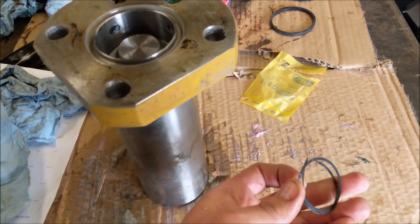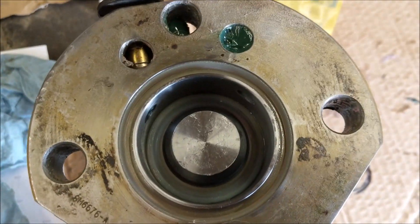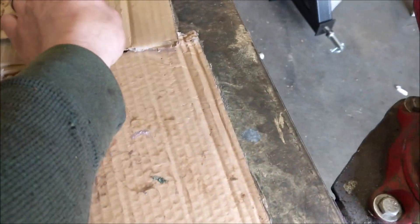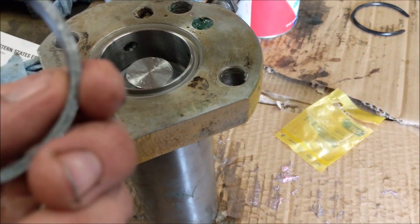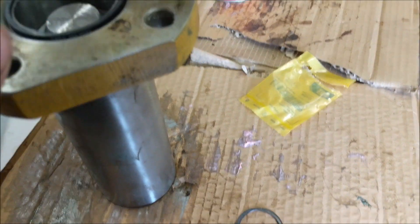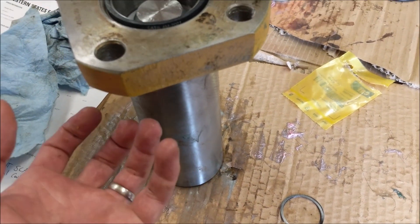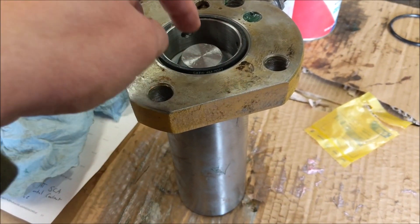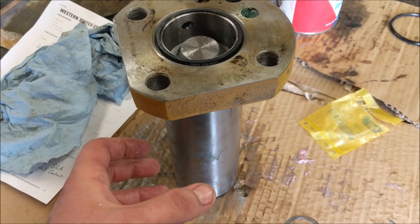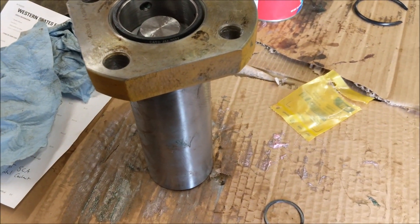I put a new snap ring on there. I'm not sure if that's the cause, but that's definitely a problem, so I put that back on. Got the piston reassembled. I'll have to go get that new seal, then reassemble it and see. My thought is maybe this wasn't a problem — maybe I didn't overdo it and it was just the grease coming from the back of the housing out as displacement since the new grease was going in. There was just too much back there. I don't know, so I'm going to put a new seal in, put it back together, and see what happens.